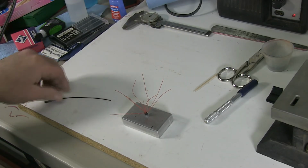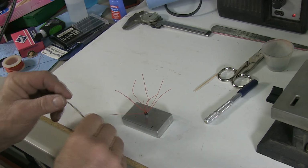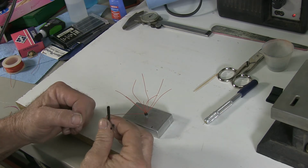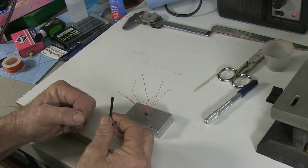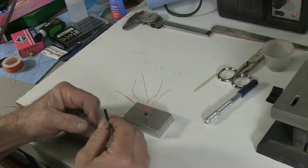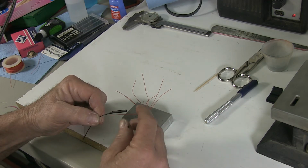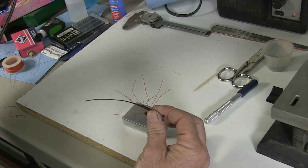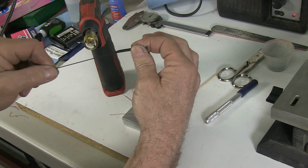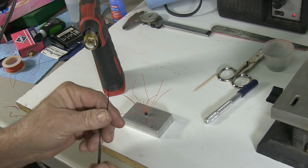Well, alright, that wasn't too bad. For the spark plug boots, I'm using this. It's shrink tubing, I think 1/8 inch, 3/32, somewhere in there. You heat it up and it shrinks down to a certain size. Well, it didn't shrink down far enough, so I took my torch and heated it up and stretched it, and just kept on going like this until I got this diameter.